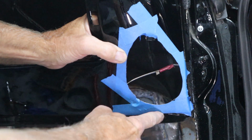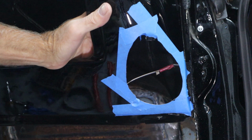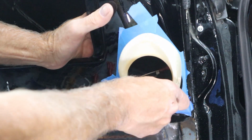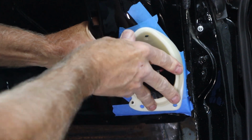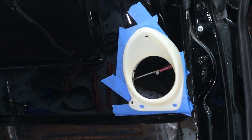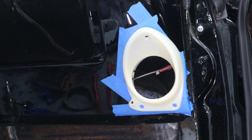1/4 inch here, let's say 5/8 right there, and then you just trim around to it. And you can tell that hole's not perfectly round or perfectly smooth, but everything gets covered up really nice and looks nice when it's all done. So I hope that helps. I know a lot of guys out there would like to put factory looking AC vents in their '65 El Camino, Chevelles, whatever, and this is a good way to do it, and those are your critical measurements.